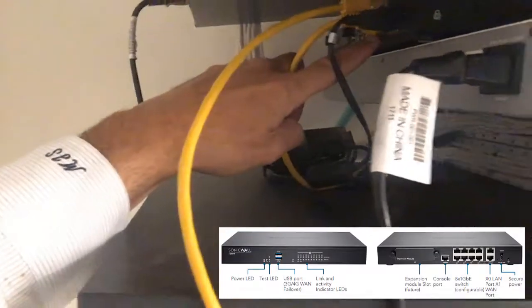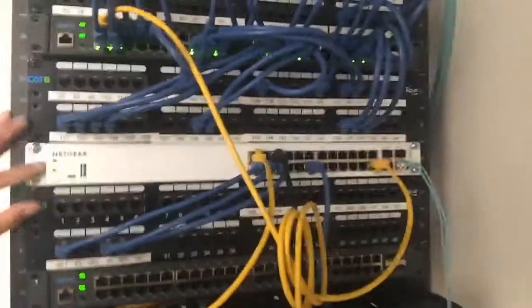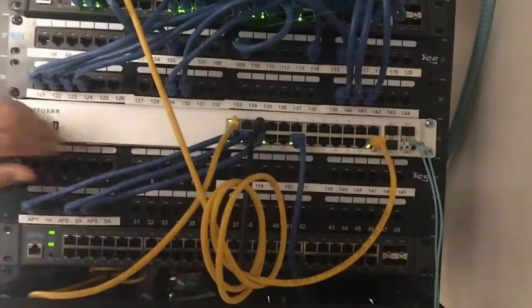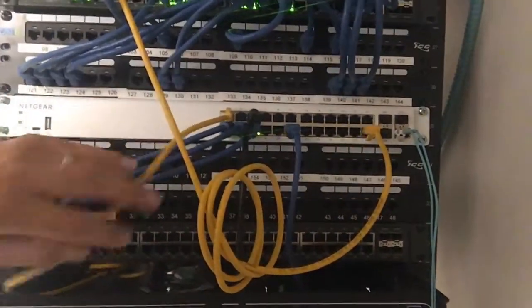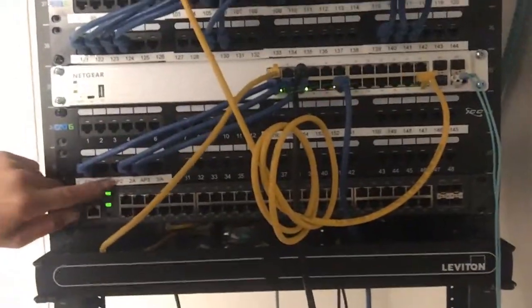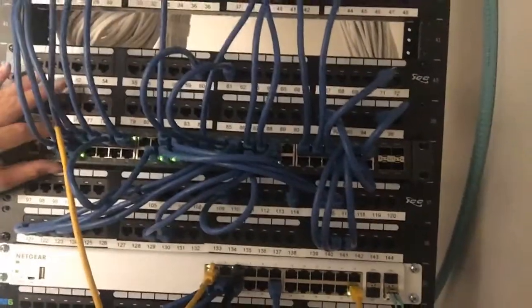That copper connection — if I trace it over here, you can see me wiggling that cable — comes back here to the WAN interface of our SonicWall. Then this over here connects out and comes up to the top left port of our Netgear. This Netgear switch is a GC728XP — it's a pretty nice switch. I use yellow cable for the uplink. I have it connected over to an access point on the patch panel, and then port number 24 is linked back up to another distribution switch. This switch does Power over Ethernet, so all the phones in the office are patched in here.